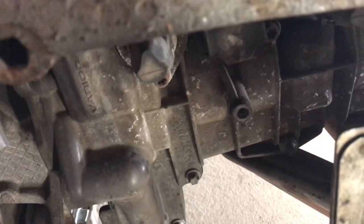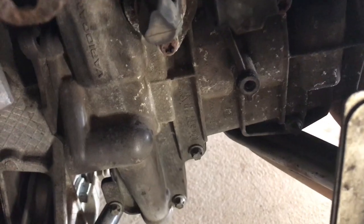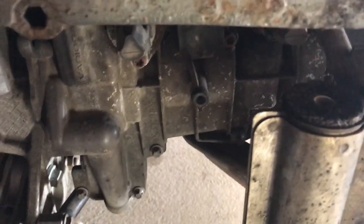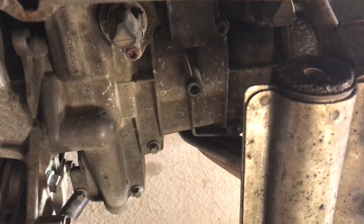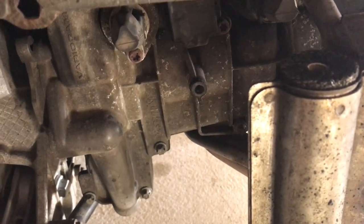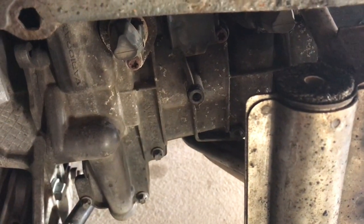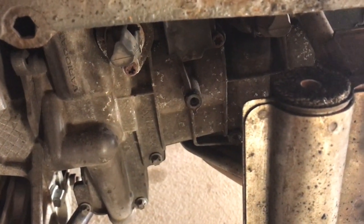Luckily, these bolts came out quite easily. Actually, I did put some WD-40 on them, but didn't really need it. They came out fine. So it's funny, it's some and some. The ones underneath, I suppose, because they see more weather and they get more corrosion, they break, they snap off sometimes in the block, but the ones on the side, thankfully, so far have come off whole.